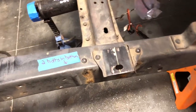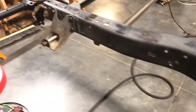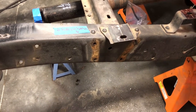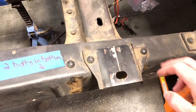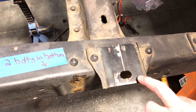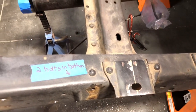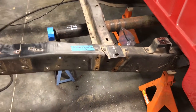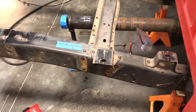I went to take off the stock e-brake cable bracket — you can see it over there, I've got it off over here — and I decided I'm going to go ahead and take off all the leaf spring mounts. They're only held in by four rivets apiece, so I'm going to take those off all the way around, because when the bed's on that might be tough. I'm also debating on, since I'm taking the two bolts out of the bottom of this crossmember — there are four bolts across the top, two that hold this bed mount in, then one underneath — putting bolts in there just in case that crossmember doesn't work, because accessing those when the bed is on is going to be tough.